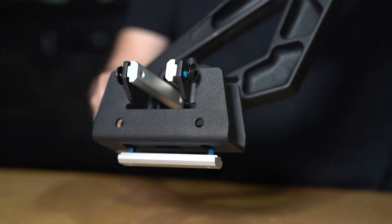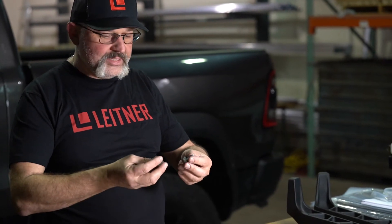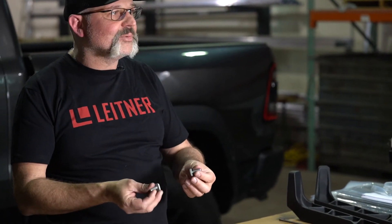This concludes the prep work of the B-upright. On page 11, it's going to be really important that the two T-nuts are slid into the upper bar prior to putting the A and B uprights on there. There's no way to install these afterwards, so it's really important that these are done before — otherwise you're going to have to take the rack apart again.